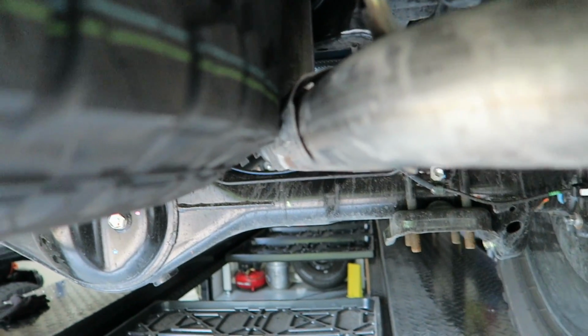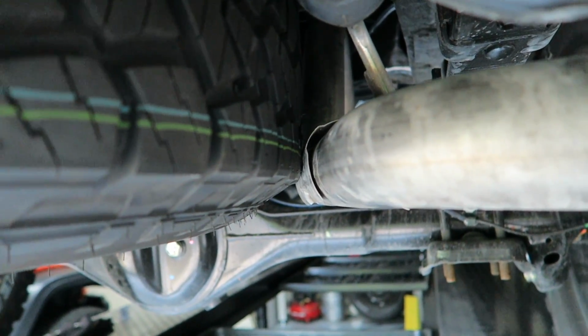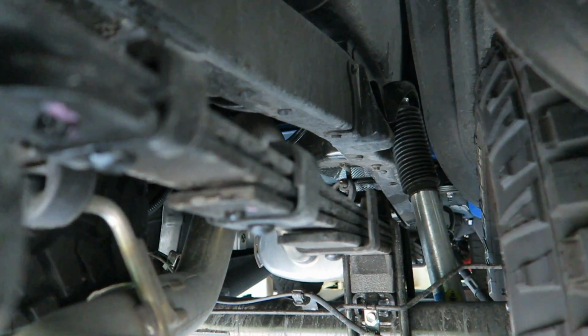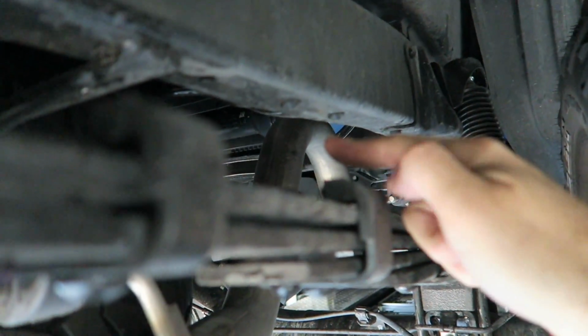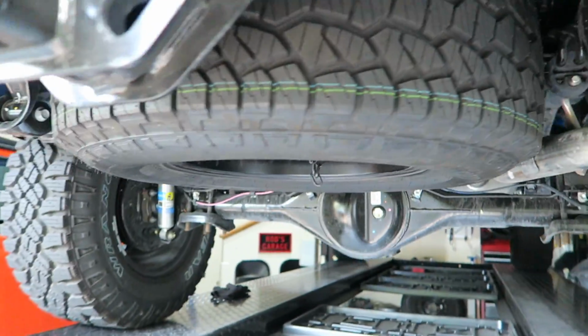It is against the exhaust, right up against that heat shield. So if I'm going to do this, then something has to go here. And to me, that means we got to cut the pipe back here. That's a whole nother undertaking, so we'll see if I actually do that. That means removing the exhaust and then taking a Sawzall to the pipe, and as I mentioned before, cutting it somewhere right here in this area, I think, just behind the tire, and having it dumped down this way.